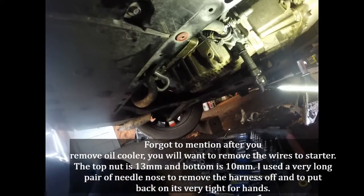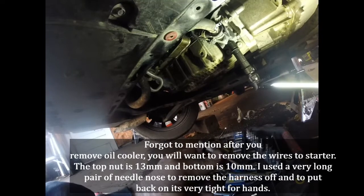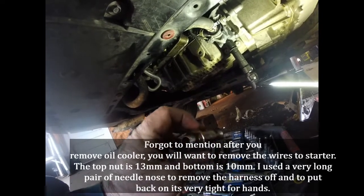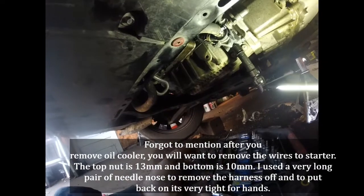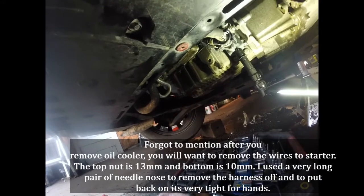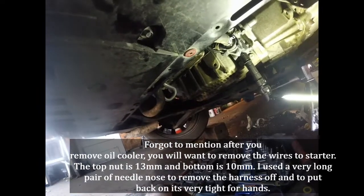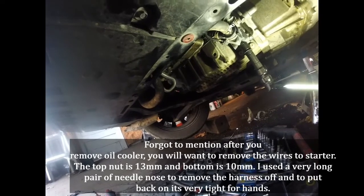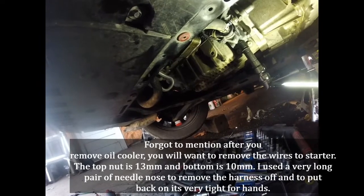Once you get your oil filter off, this is what holds your oil cooler in and it mounts like this — the side with the long threads goes towards the block and your oil filter obviously goes on the other end. This is right in the middle of your oil filter housing and I used a T60 to remove it. If you're taking it off, take your oil filter off first, then you will find this bolt right in the middle of the oil cooler. Use a T60, take it off, back it out all the way and you will lose some oil — so put a pan under there, let it drain for a while before you get back under there, then follow the rest of the steps.